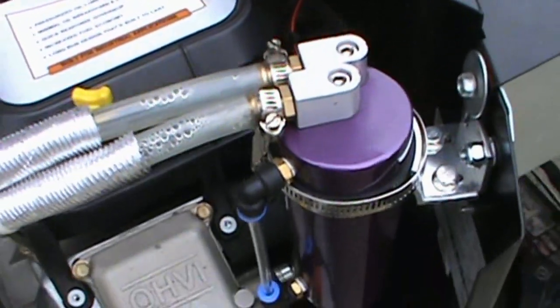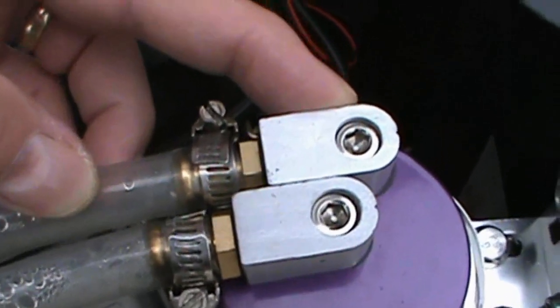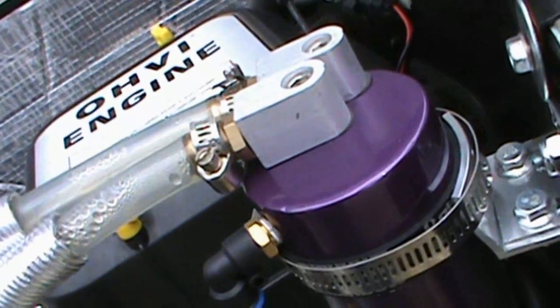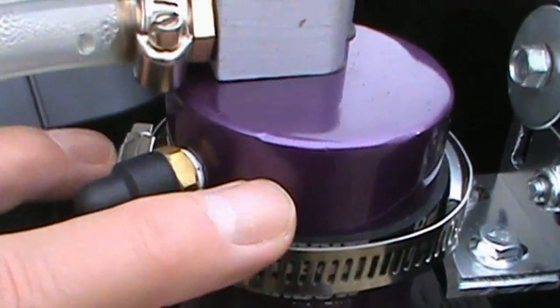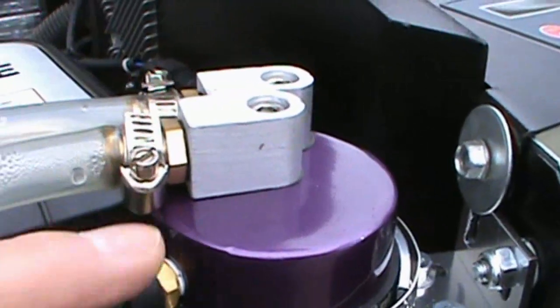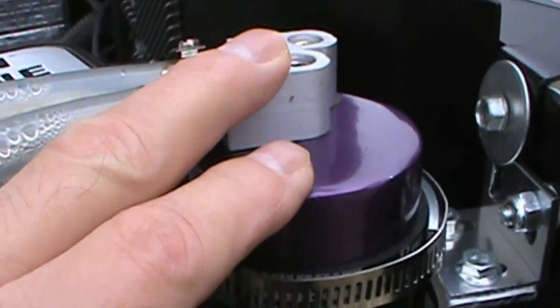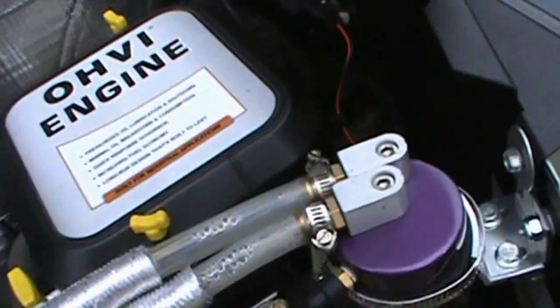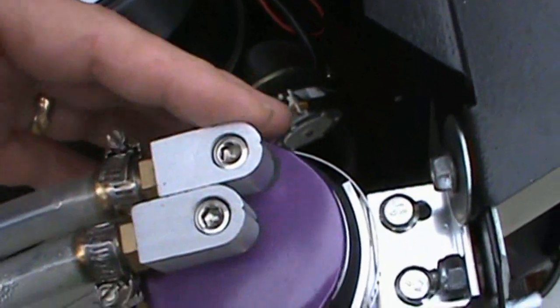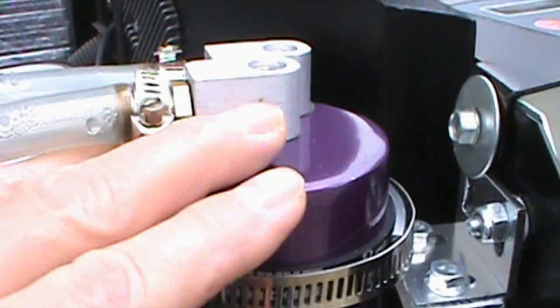One thing I was a little concerned about originally is the intake tube, which is this one over here. It dumped right under the head here of this little chamber, and I was afraid that sludge would come in here and dump just under the top of this little chamber and be cross-vacuumed into this port and sucked right back into the carburetor. So what I did was take a little brass tube and put a little drop tube on this intake, and it now comes down probably about 30% into the inside of this chamber. That allows it to dump the oil closer to the bottom so I don't get cross suction.